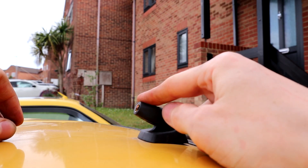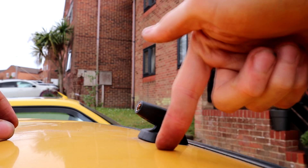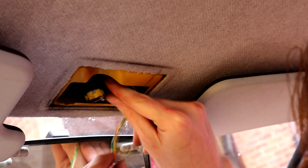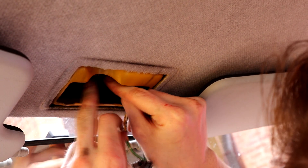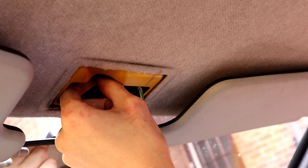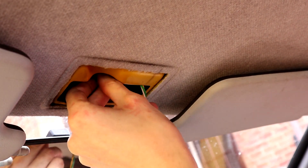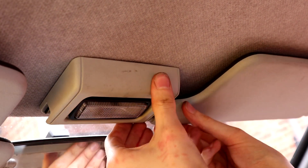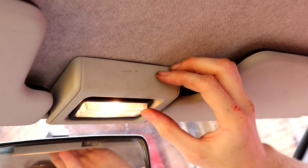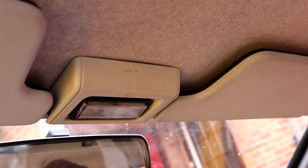The aerial itself is unfortunately still in the post, but as soon as it arrives we screw it in, plug a head unit in, and we've got some banging tunes in the Peugeot. For now, we thread the dome light over the aerial cable thread, push down from above to seat it, and the new aerial base is on. The sun visor clips back in, and that is how you change the aerial base in a Peugeot 205.